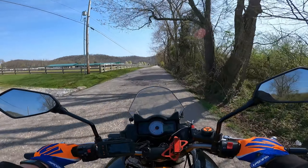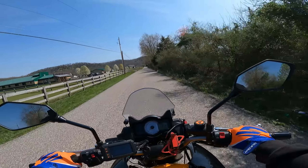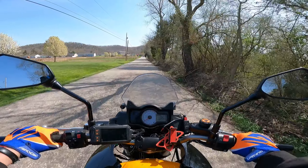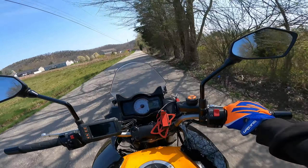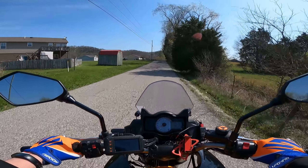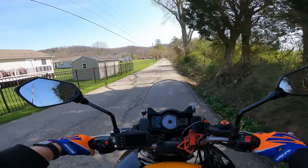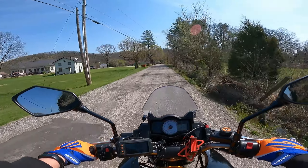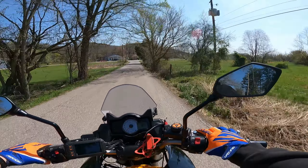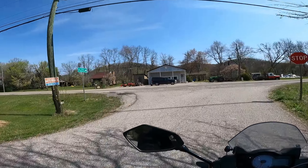The only other negative thing I've seen about this tire is that it slows your steering down. Yeah, it slowed my steering down enough that I noticed it the first ride, especially at lower speeds. But after the second ride, I can't even notice it anymore. All I can say is, if you want that street bike track steering, okay, this is going to take away from that a little bit. If you want more of a dirt bike or adventure bike steering, that's what it's going to give you. So it's not a negative in my eyes.